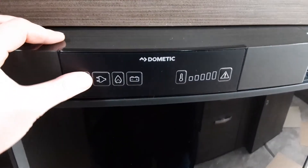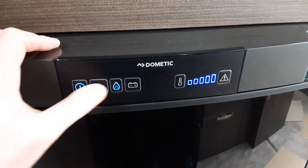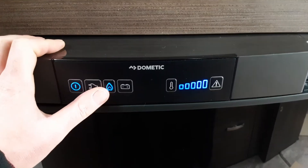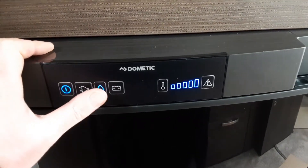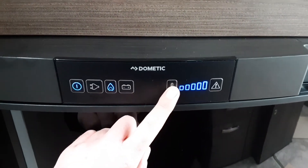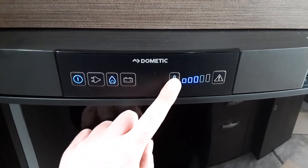Going around the caravan, you've got the fridge — it's very easy to use. You've got power on, and at the moment it's trying to ignite on gas, so it will self-ignite on gas. If it doesn't ignite, it will flash blue here and flash red on the exclamation mark on this side. If it does ignite, you've got the temperature control just here.